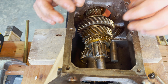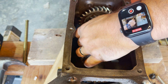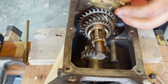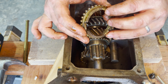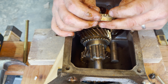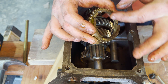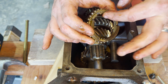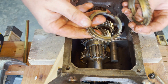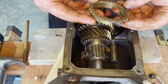You can see there are two sets of synchro teeth because there's another synchro ring back there, and the other teeth are attached to second gear. One thing you're looking for is any excess wear on those teeth — they should be sharp, shouldn't be rounded off or dulled down. You also want to make sure the grooves inside that help move the oil aren't smoothed down. I'm going to replace both of these synchro rings just to be sure — they're not expensive.